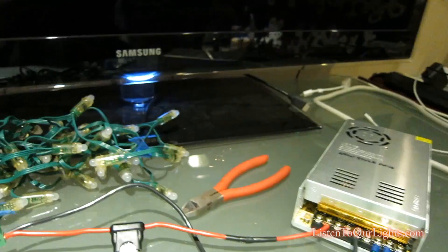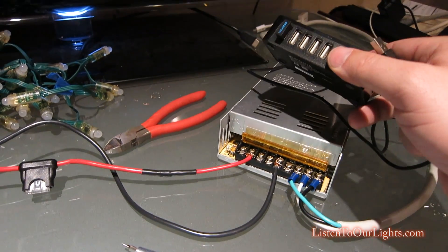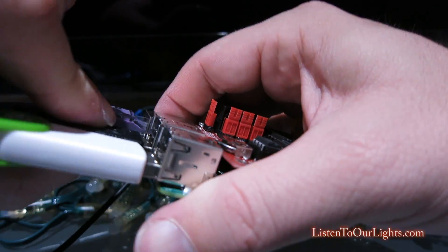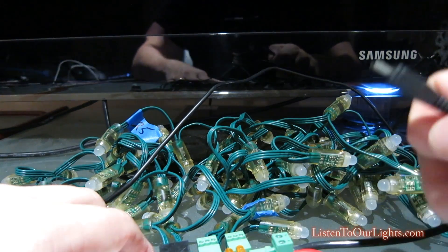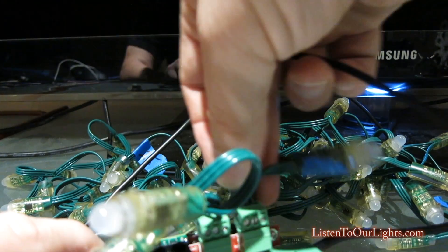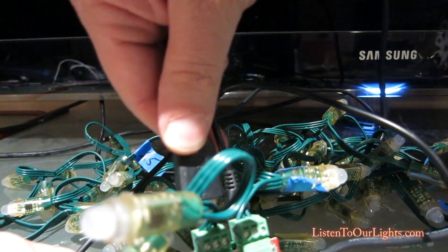The other thing I need to do is hook up this wireless connection — I got a little 802.11 wireless adapter here. But I just put it on a powered hub — I do the powered hub that way I know the wireless is getting enough power to do its thing. And here I'm just plugging it into the USB connection. Then the last thing is the power connector for the Pi itself. And just for grins, I'm going to get the HDMI connector and plug it onto the TV so I can watch it boot up.